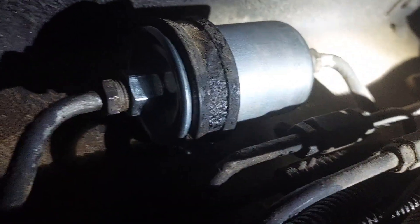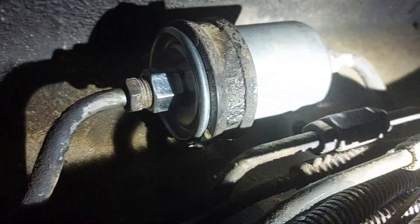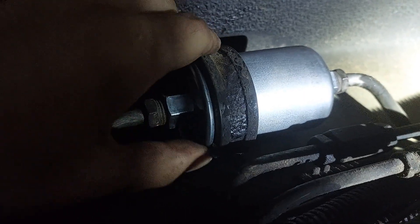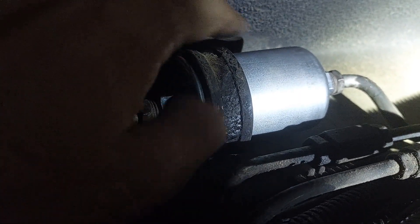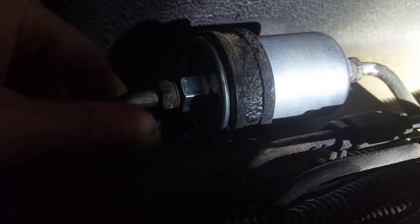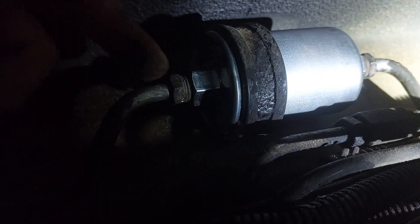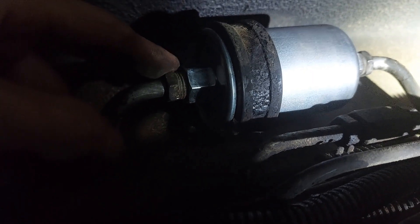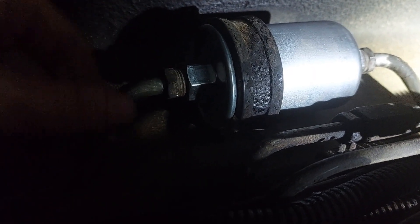Okay, quick pro tip. I found that I could not get enough slack on the front fuel line to do anything. So what I did to get it in is I actually swung the clamp back — I tilted the fuel filter up like that — and that gave me the room to bring the fuel line back in line, and then I brought it back down. I was able to push the flared end of the fuel line in and start screwing this in. The back has some wiggle room, so you just got to pull it back forward and tighten it back up.